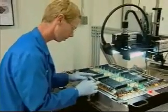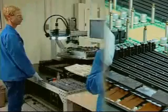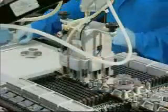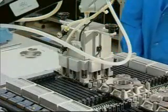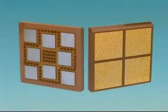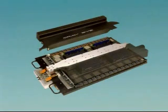After surface mount technology is applied, we put the edge flex onto the printed circuit board — components similar to those used in previous Cray products. The chip packaging and mechanical implementation of the SV2 is key to achieving the system's compact footprint. By using the multi-chip modules, we were able to get four processors on the same board, giving them access to shared memory with very high bandwidth and low latency. This delivers the computational power of a full 32-processor Cray T90 on a single processing board.